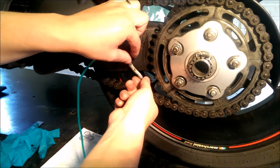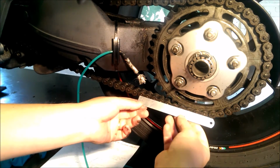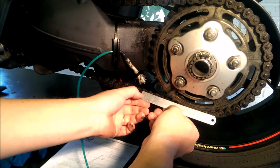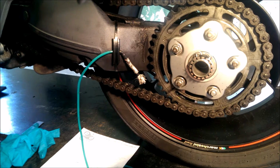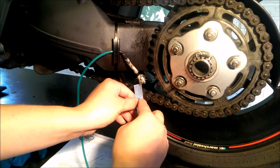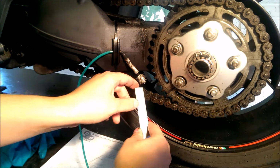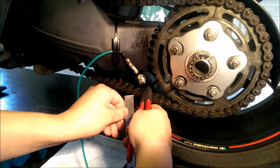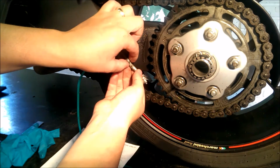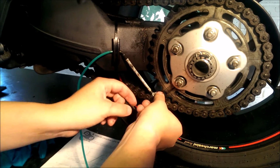Number 2, it will be just using the collar, pull the collar up the feeding tube. Okay, and we're going to be cutting 75mm away from the rear sprocket and 20mm above. Now all these measurements are with someone sat on the bike, so we're going to make compensations for that. So we're going to make it 25mm from the chain upwards. Now we've already cut ours, but all you've got to do, as I said, 25mm away, and then just snip the end of it. After you've done that, you're going to need to be pulling this one down over the end of the wick, and the little black collar you're going to need to be pushing upwards.